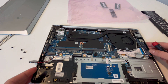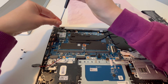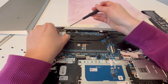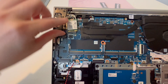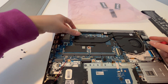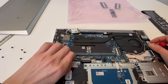I'm going to start unplugging different components — my Wi-Fi card here. About the BIOS reset: if you accidentally take the CMOS battery out, I have a video in the description on how to set the date and time if you get an error. These little wires attached to the Wi-Fi card are really hard to reattach, so I like to just take the whole thing and set it aside with the two little wires still attached.